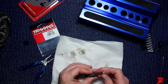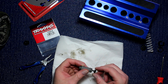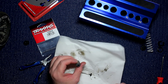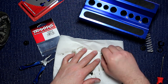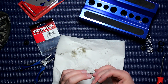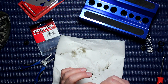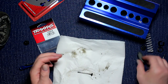While we have it in our hands we're going to clean it. What we're going to try to do is push the shock inside and bring it out on the other side. Now I'm just going to inspect the O-rings here — they seem more than fine. I'm just going to dab them a bit on the paper. I don't want to score them or rip them apart, because they are in perfect condition. Now we're going to put the shock body aside.